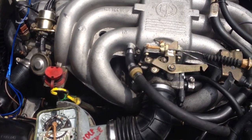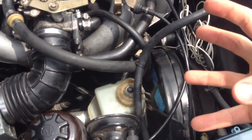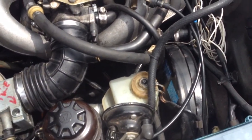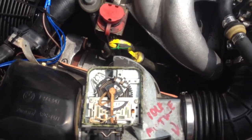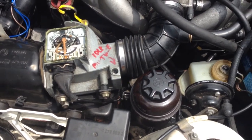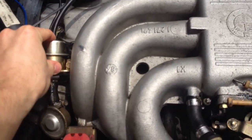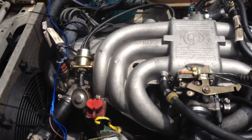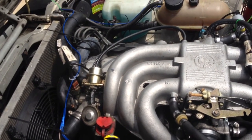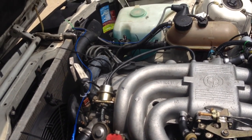not leaking. I had some leaks down here on my master cylinder. Put some non-hardening silicone on there. Get some non-hardening silicone on everything possible that could be leaking vacuum, because that's controlling your fuel pressure as you mash on the gas, and your ignition. Go through it.